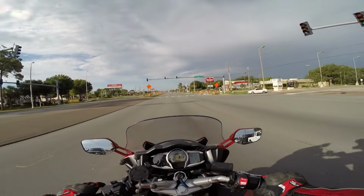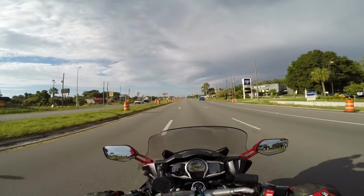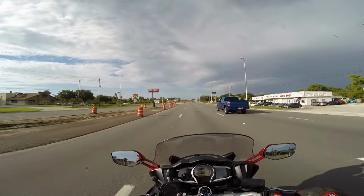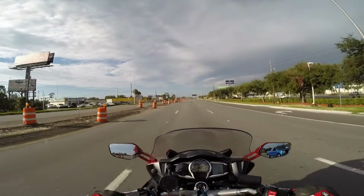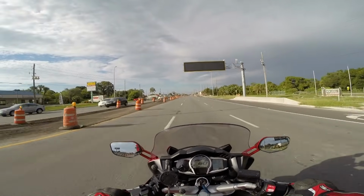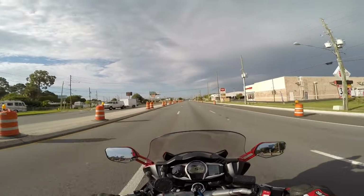They have what are called sliders, which are basically wear items. So if you drop your bike and it's sliding on the ground, you're not scratching up your very expensive plastic panels. You're scraping away these frame sliders, which are like little rubber pucks, kind of like hockey pucks, and they're sticking out a little bit from the side of the bike. Now, that doesn't obviously guarantee you're not going to have any other damage, but they certainly do work in some kinds of crashes or drops, especially if it drops in a parking lot.